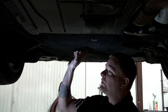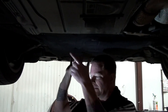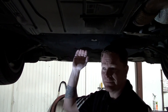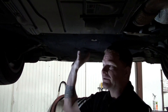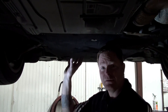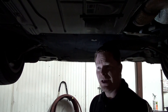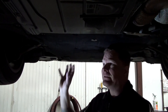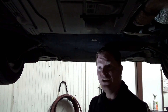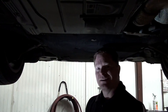We've got the car up on the lift. One of the very first things you're going to want to do is pull the belly pan — there's about a dozen eight millimeter bolts that keep it on. If you haven't pulled your belly pan off recently, keep in mind you'll probably pick up a bunch of garbage on top of it — gravel and who knows what — so don't get a face full of dirt. I'm on a lift here at the self-serve garage, which is really nice. If you're doing this at home with a jack and jack stands, that's absolutely possible, but make sure your car is on four jack stands. Do not do this work just under a jack. I'll pull all these bolts, pull the belly pan, and show you what's next.